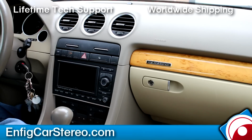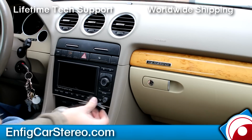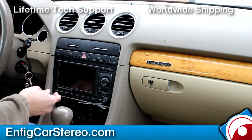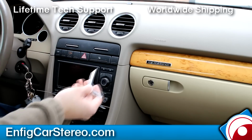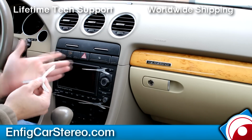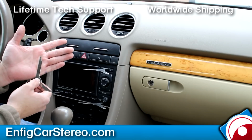Alright, so first thing you're going to do, take out the radio. You're going to put your radio removable keys in, notch facing towards the center. It doesn't hurt to give them a little bend. If you look, some of mine are bent, so I always like to bend them towards the middle. It gives a better grip. So as always, on the left, the notch faces right. On the right, the notch faces left. So the notch always has to face towards the center of the radio.